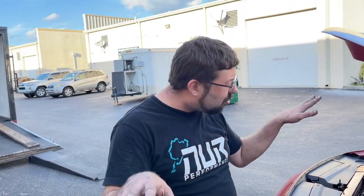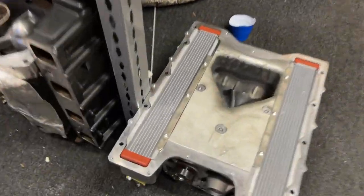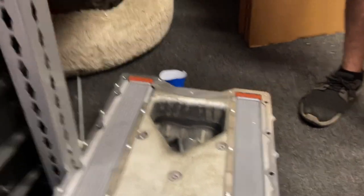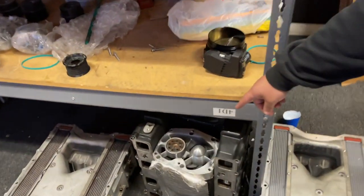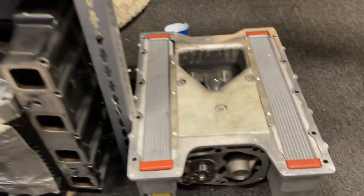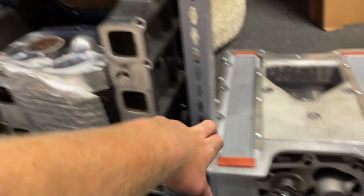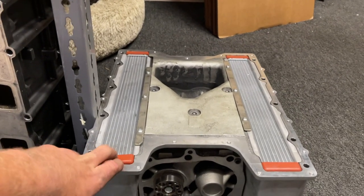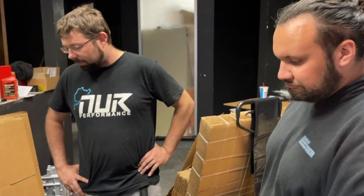This is a supercharger off of a Hellcat. All of these are Hellcat blowers. This one is a 2.7 — that's off a Red Eye. You can tell the difference by how the pin is pushed out. This one is a 2.4, off of a car like mine — the pin is pushed in. The difference is the rotors are just a little bit bigger, which is why it pushes out the bearing plate. Basically all they did was make the bearing plate thinner so you could fit a bigger rotor — not really too different otherwise.